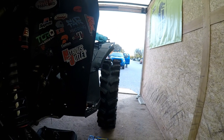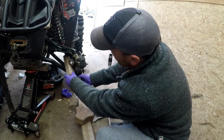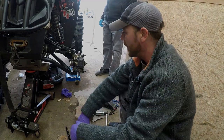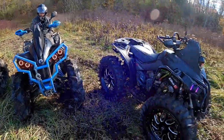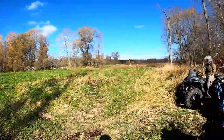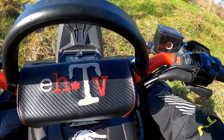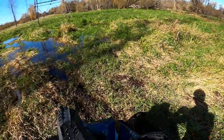We got a helper just arrived — right on! I'll spray down these bolts. Snap a two-by-four in there to stop the axle from spinning, grant on the brake and holding the bar straight. Welcome back for another episode of ATV Man. We got the axle stabbed in there, thanks to Grant giving me a hand this morning. Also found some tie rods loose — tightened those up, and an arm adjustment bolt a little bit loose — tightened that up too. She's tight in the steering and shouldn't drift anymore. Brand new axles — we'll go easy on her and let her break in.